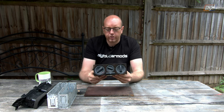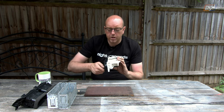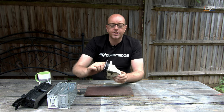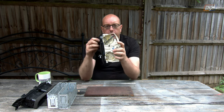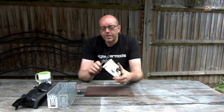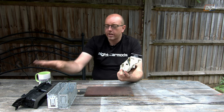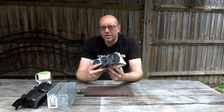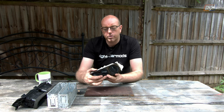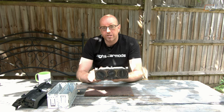Before I found that I was going to use a Passat or Mark IV Golf, circa year 2000, VW heater control unit. It has a much longer throw on its heater control so we'd potentially have to gear it down or use less of the sweep, which isn't ideal. It also has a big selector with two different arms on cams that move in different orders to select different air routing — but we have no need for that. We only have four outlets with butterfly valves, so the only piece we actually need is the four-position rotary switch, though one position will be superfluous since our fan only has three positions.